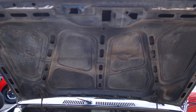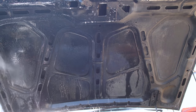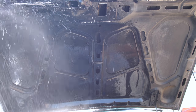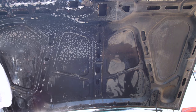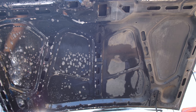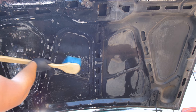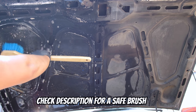We're going to start off by cleaning the hood and working our way down, so you avoid dripping dirt on a clean surface. Simply rinse off the thickest layer of dirt with water — if you have a pressure washer, this is a great place to use it. Once you remove the thickest layer of dirt, spray a moderate quantity of degreaser. A quick tip is to divide the hood in half so you can avoid the degreaser from drying off. Once you apply the degreaser, scrub the area going up and down or left and right — never in circles. Apply medium to light force to avoid any swirl marks or scratches. Do not use a stiff brush, as it will work like sandpaper and dull the color of your paint.